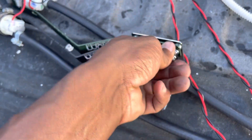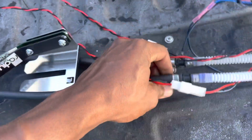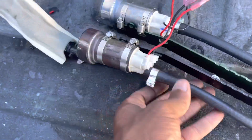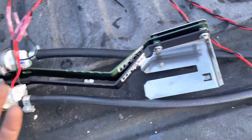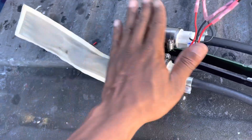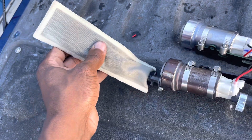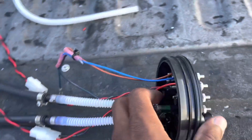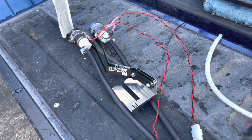Once you get that inside the tank, put both of these on and tighten them down. Make sure those are tightened down good so this doesn't come loose in the tank. It's pretty much just regular 3/8 hose and some clamps. I like to put all matching clamps. I thought I was going in today until I realized I didn't have the other sock. I think they're Honda socks — like Prelude socks — that are pretty close to the S14 fitment. You can look it up online. This is the Radium $500 twin fuel pump setup.